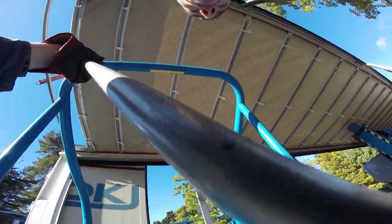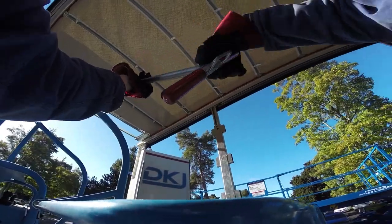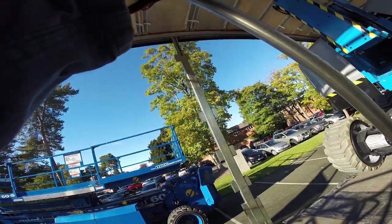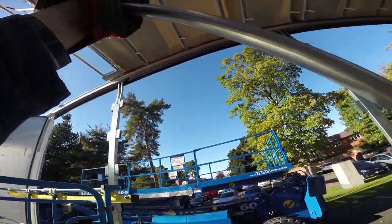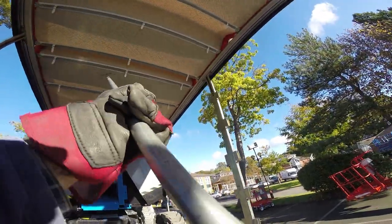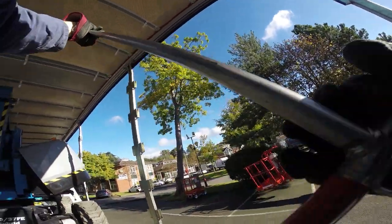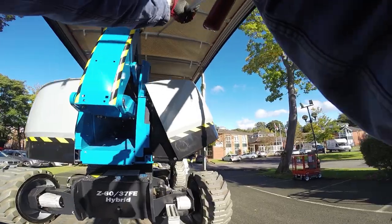Never move the roof by pulling it at the wire, which is there for locking up the roof. Pull the roof just out of the safety lock with it. Then grab the roof by the iron beams and pull or push them. Or walk next to it and pull it by the cord which is hanging there, when you don't have the space in the trailer to pull it or push it there. The iron beams are the best. That's the strongest feature in the roof.